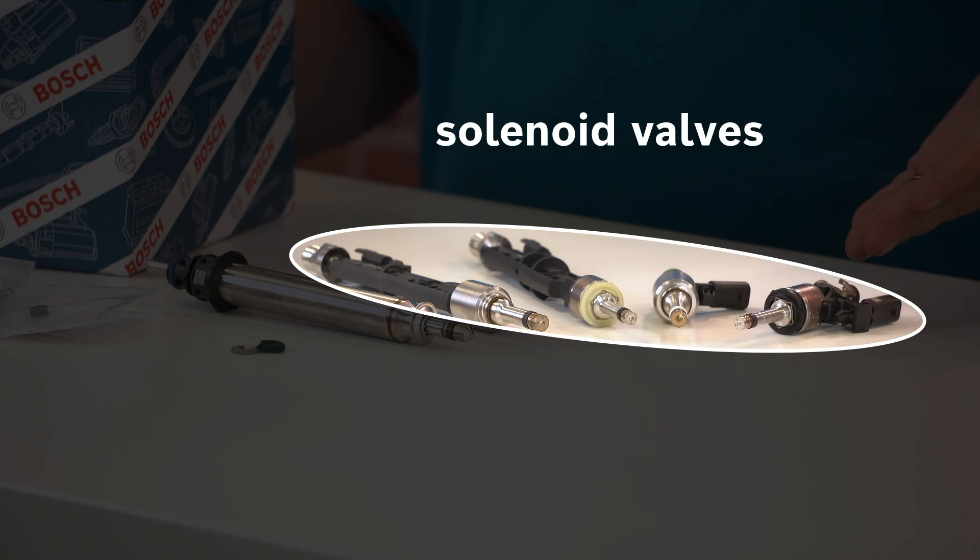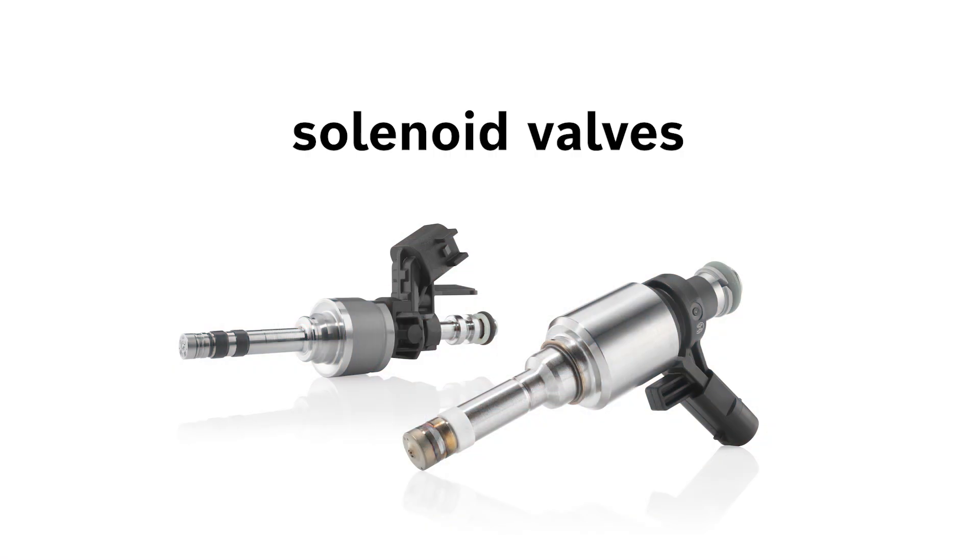What types of injectors does Bosch offer? There are two types of high-pressure injection valves: piezo and solenoid valves. Piezo valves have advantages in their opening speed and in the distribution of the fuel, however they are very expensive. Since the current generation of solenoid valves is getting just as fast, the piezo types are getting rarer in future. That's why today we focus mainly on the solenoid valves.